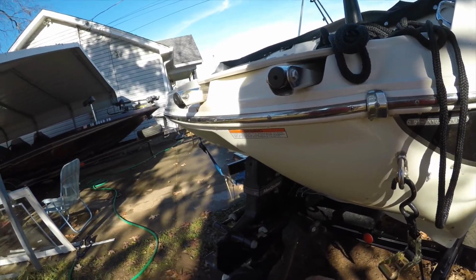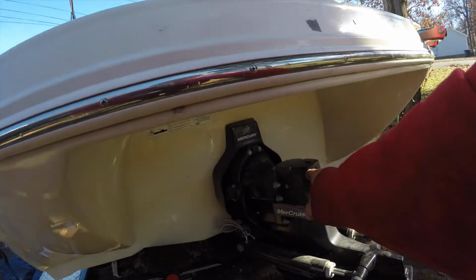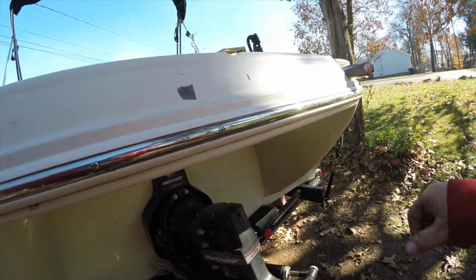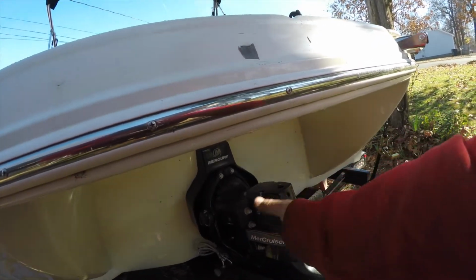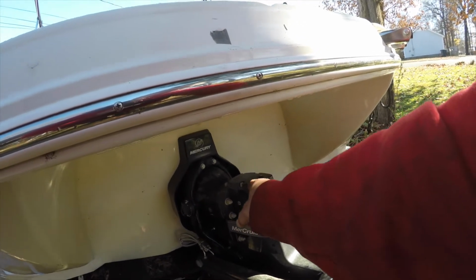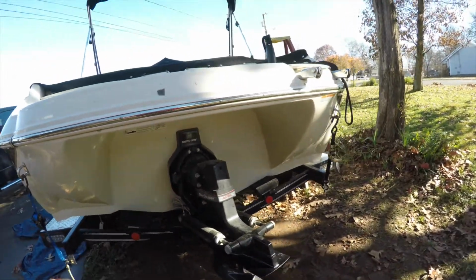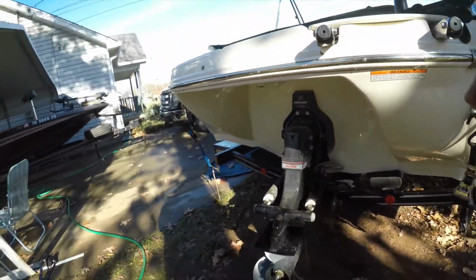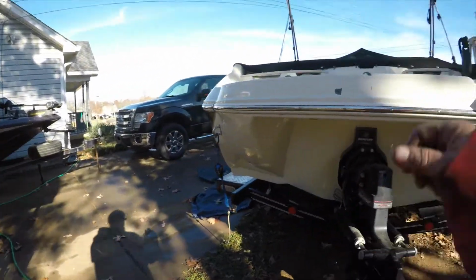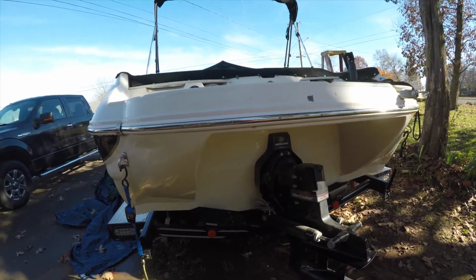But then when you're pumping it up, you can leave this vent screw still there. Still going to force the air all the way up through the reservoir, and you don't have to take that off. At least I don't think you got to take that off. I don't see what difference. That's not going to hold any air. And if you think that it is, you put the vent cap back on, do about 3 or 4 pumps, and then go up in the engine and take the reservoir cap back off.